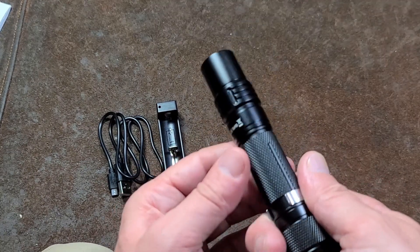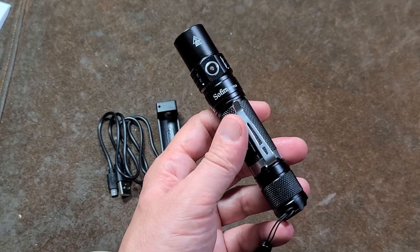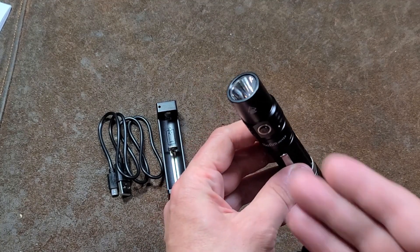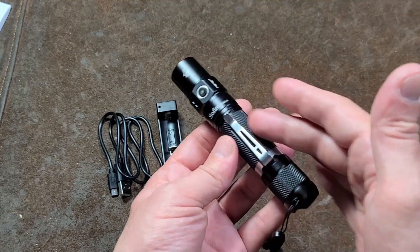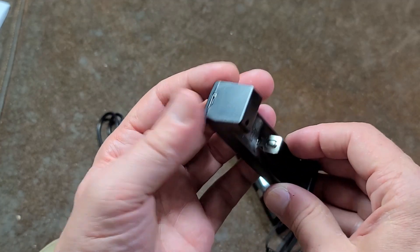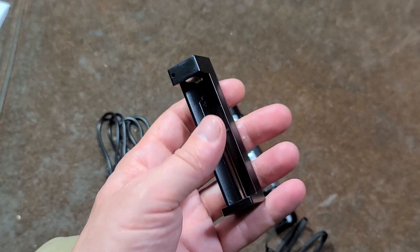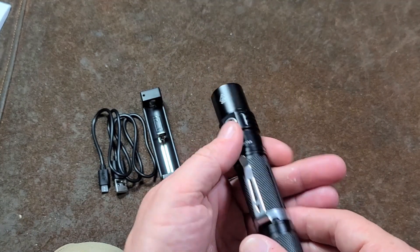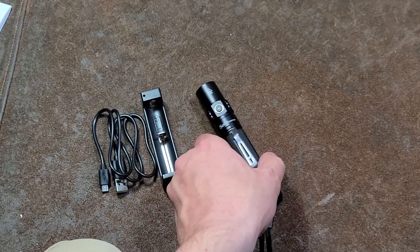That's my review, and I have to call it like I see it — which is why I even took this as a promo. This company is selling you a light that genuinely delivers bang for the buck in so many areas: coated glass lens, replaceable 18650 battery including a 3-amp cell, dual gold-plated springs, and a bonus slow-charge USB micro external charger that actually works with any lithium-ion battery that fits — not just 18650s. The intelligent dual-switch system lets you set your power level and just use the hard switch without cycling through modes every time.